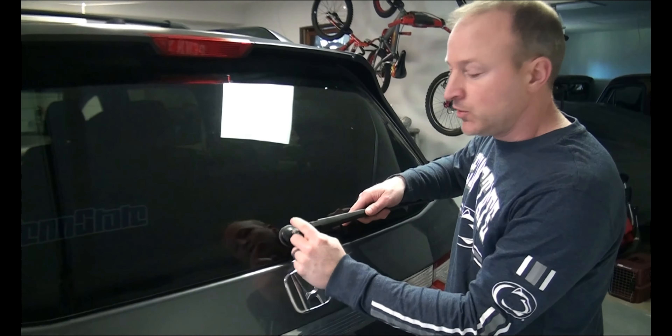And that's it — that's the whole wiper arm. The blade itself is also pretty similar on most vehicles. Super easy — you tilt it and it pops right off. You're going to get this little groove right here, put it on the new one, snap it in place and that's going to be it.